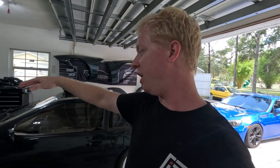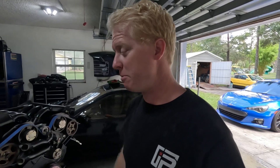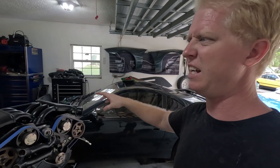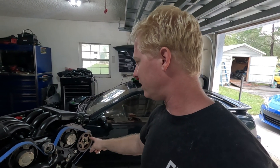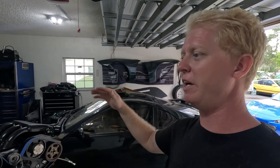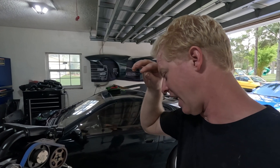When I first put the motor together, I put it all together at TDC. After some brainstorming and talking to some other guys who have made serious power on these motors, I went ahead and skipped a tooth on the cam gears. I believe I advanced the exhaust gears and retarded the intake cam gears by one tooth. But that's not how I want to do things — the proper way is to get adjustable cam gears, which I have since done.